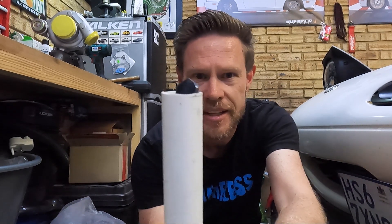Two things we're going to do here: we're going to leave the oil in as recommended, so that when you drill, the oil coming out will help push shavings out. We're also going to coat the drill bit in grease, and that is going to help catch any of the shavings. We're going to go pretty slowly, and because the pickup line runs right behind where we're drilling, we need to stop this from penetrating too far — and to do that we're going to use this sleeve slipped over the drill, so I can only use so much of the drill.